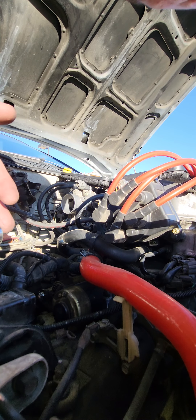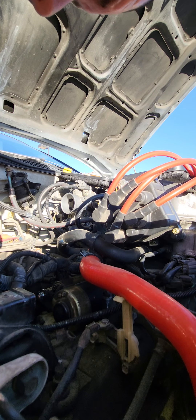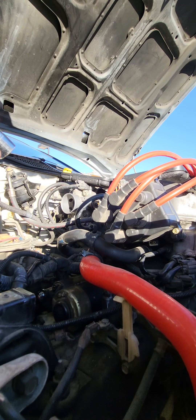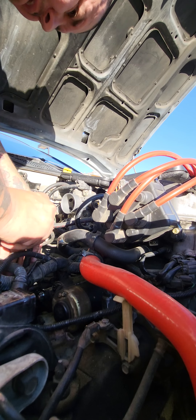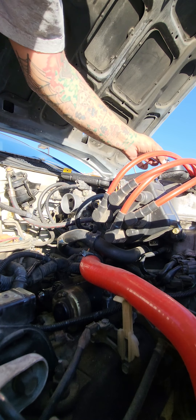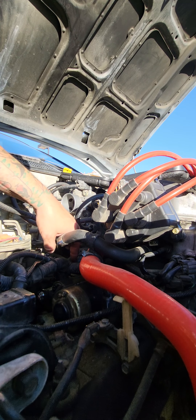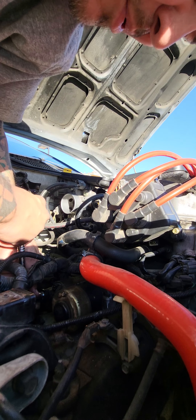Always disconnect your battery on the '92–'95 Civic when working on the starter because you're working with something electrical. I even disconnect it when I'm working on my thermostat, because I learned the hard way — one time my thermostat fell on top of my starter, grounded it out, and blew my fuel relay underneath my dash. That was stupid, but nobody's perfect.